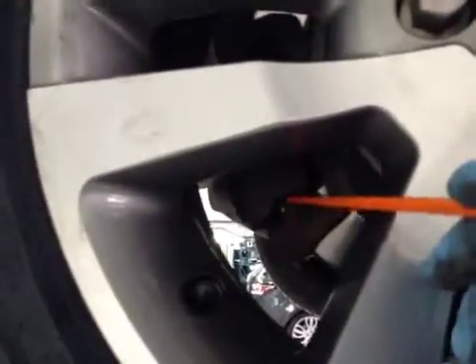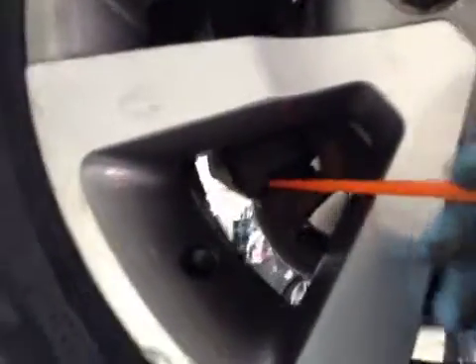Driver's rear tire — tire is in amber, just below 5mm, no sign of foreign objects inside the tire. Rear disc is in okay condition and your rear brake pads are on 2mm, so it does require a set of rear brake pads. Rear disc is in green, tire is in amber, rear pads are in red.